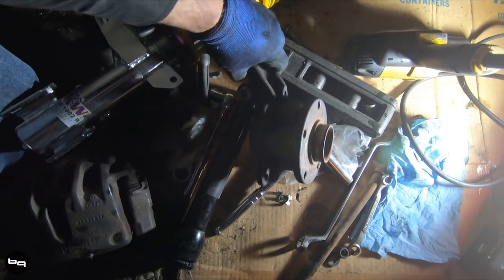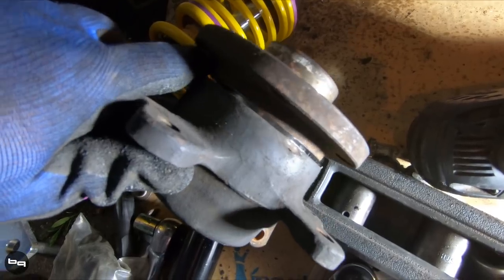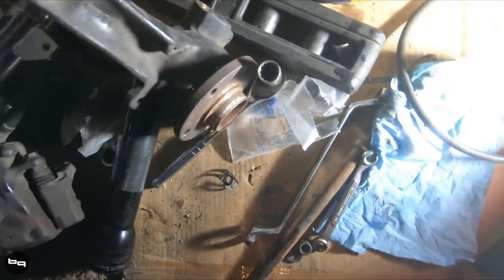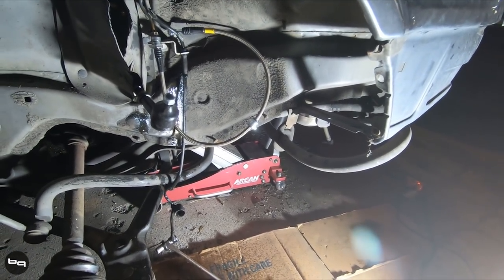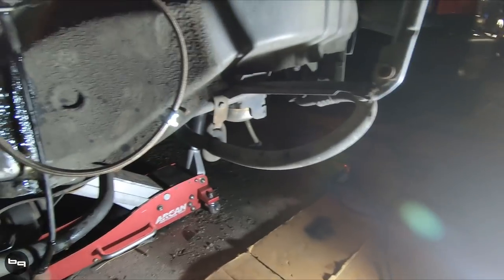Got the stuff out, now we're going to put stuff in and see how it all works out. Back from the garage with some goodies - KW V1s already converted with pressed-in hubs. You can see it was machined there to fit - this will put it right where we want it. We've got Goodridge stainless brake lines and a Brighton Engineering brake bracket. I have a strut mount with a castle nut that has to go in - I have a castle nut tool, so we put that on and mount it in place.